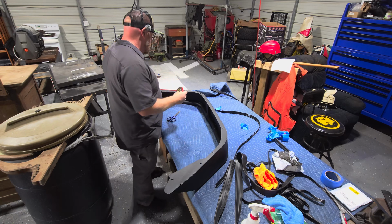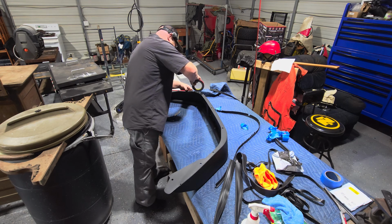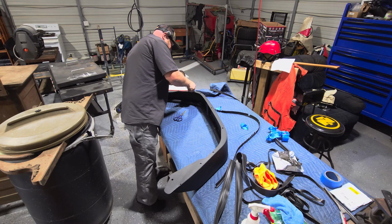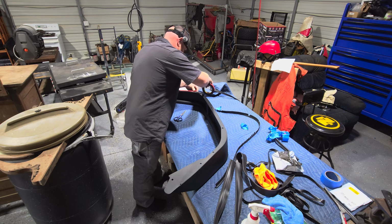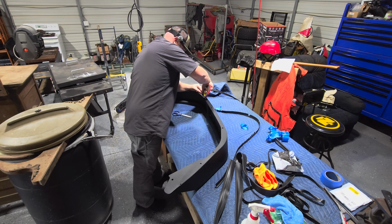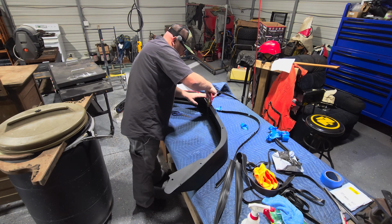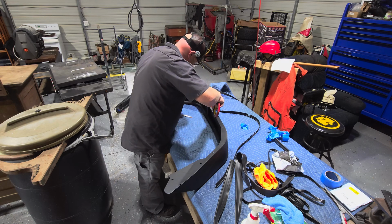We will get our scissors and we will cut around the bolt holes. We'll cut around the radiuses as well here. You can cut a radius in this stuff, just like you cut the radius in the welting. Just give it a little bend. You don't want it to stick out above the fender because you'll be able to see the tape. We don't want to do that.